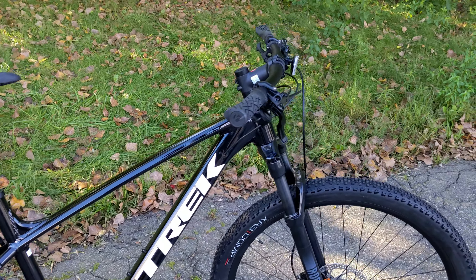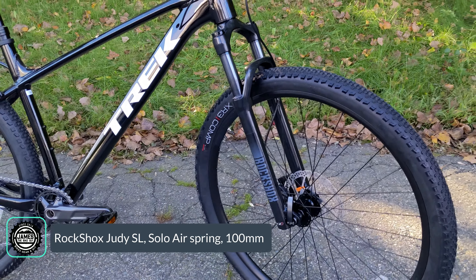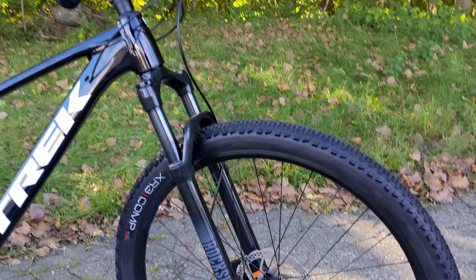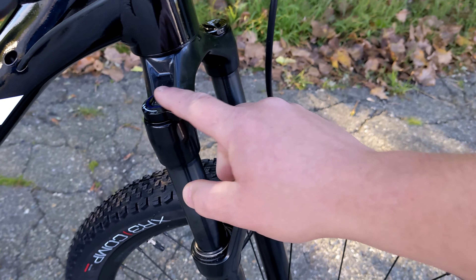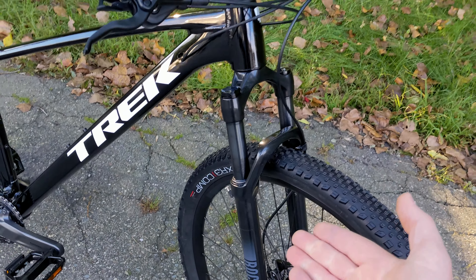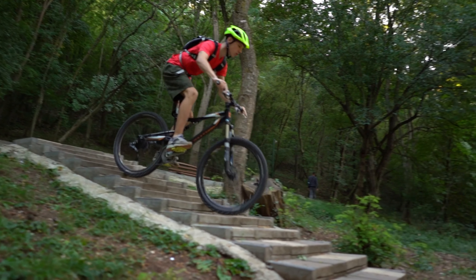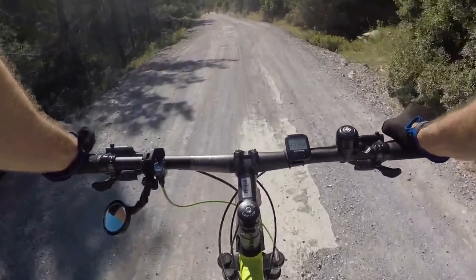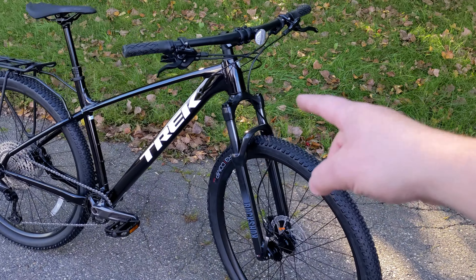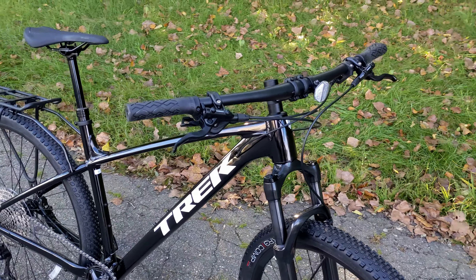Going forward to give some of that additional flexibility is a RockShox Judy. The RockShox Judy is a mid-level suspension fork — this happens to be the SL version, which means it's got a motion control damper, 32-millimeter stanchions, and is air adjustable. This has 100 millimeters of suspension travel, so you could crash over curbs, go out on fire roads or dirt paths that a park ranger would need to do. It can be set up for all different weight types, so different riders could adjust it to what they need.